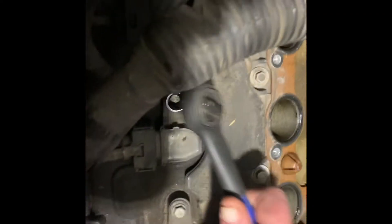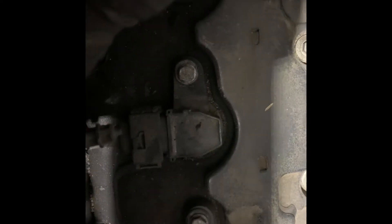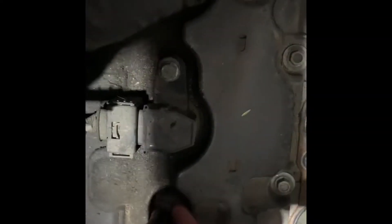Now that the plenum's off, the next job is you can get to the injectors. These are the coils here for each cylinder. Number six was the one — which would be this one here. We need to pull this one out and change it with the spark plug. That's the one that's missing, so that's the vital one. But we're going to pull them all out.